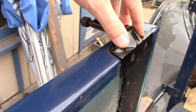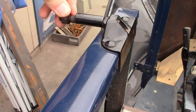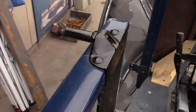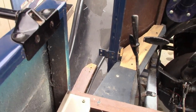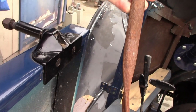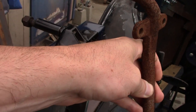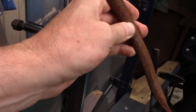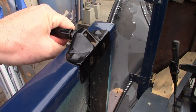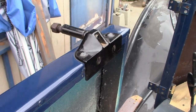Next thing to repair is these top brackets. I homemade these and they just bolt on here. They were fine when they were new, but after some time the top has put a lot of stress on it and it's loosened up this whole section here, so it's bending down. Now on original Ford bodies from this time, the top bracket has this leg on the bottom that goes into the body. At the time I put this cab together I didn't know why they did this — I thought it was just an additional brace — but apparently the reason is it keeps them from falling down. So I'm going to take this off and weld a piece on it that goes down, and that should fix it.